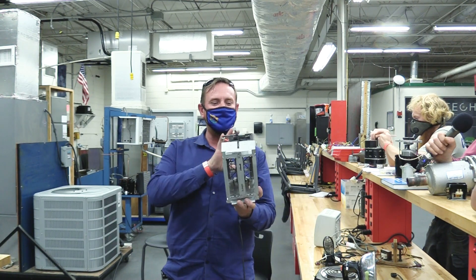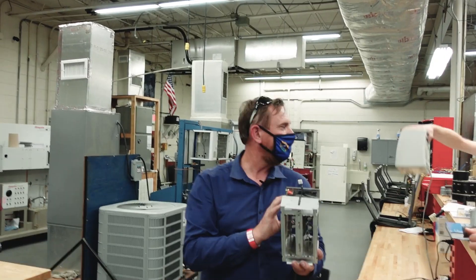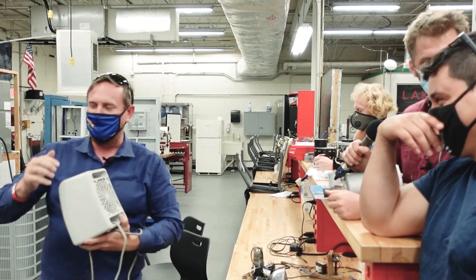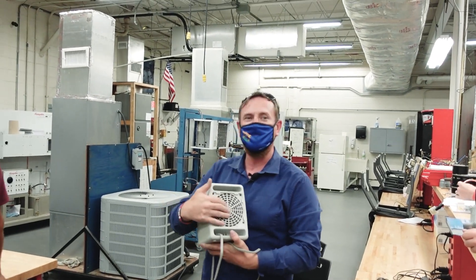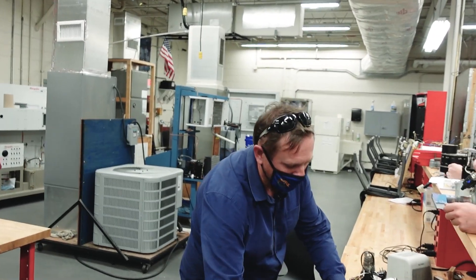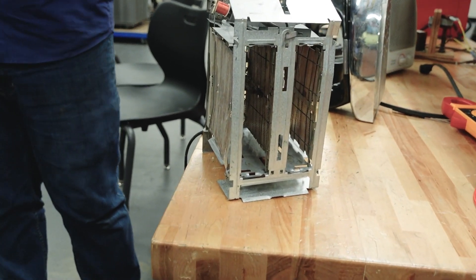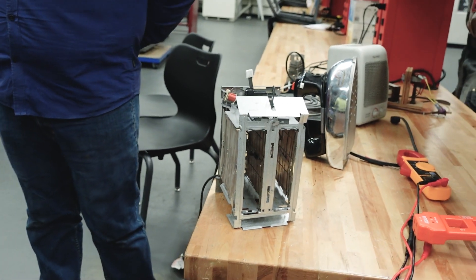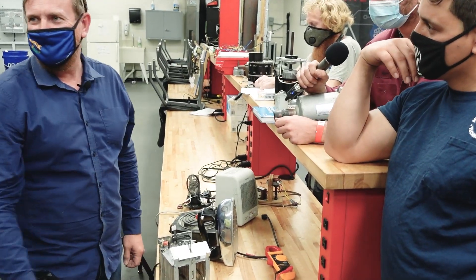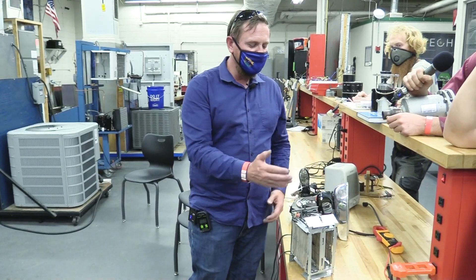Now let's think a little bit farther. What would happen if I put a fan — I've left the toaster together — and I was to take that little tray and put a fan on the back side of this? You'd have a hair dryer. Yes — this is nothing more than resistive heat elements with a fan behind it. It's a small fan, but it still has a fan behind it. So you move air across the heating element and you have a heater. If I put a small fan behind my toaster, would it have a safety built in? If it got too hot, was there anything to save it? Yes — the bi-metal. That bi-metal would work as a limit switch. If it got too hot, it would hit this, pull the top up, and the unit would shut off. So much goes into this — this actually converts to electric heat.